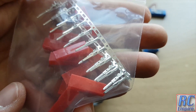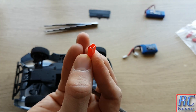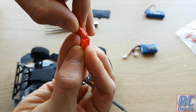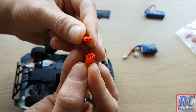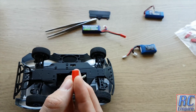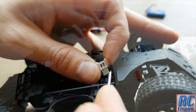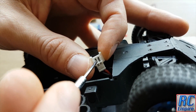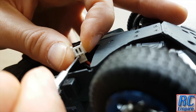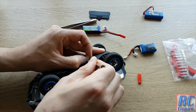You can see what these little tabs here are — they just keep the terminals in place in the plastic connector. And quickly, these are just the new JST female connectors that we will be fitting to the car. To remove the old connector carefully, get a small screwdriver or needle point and push in these two little tabs, and the old connector should just pull off.